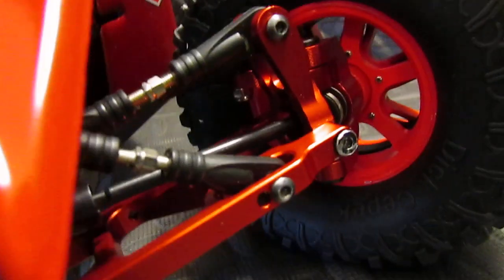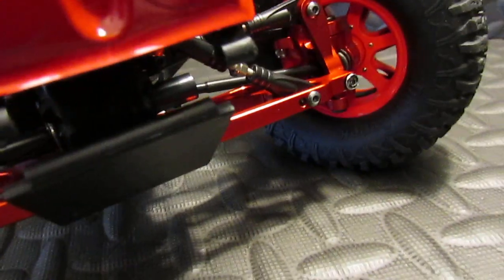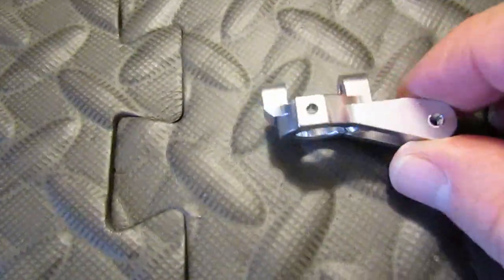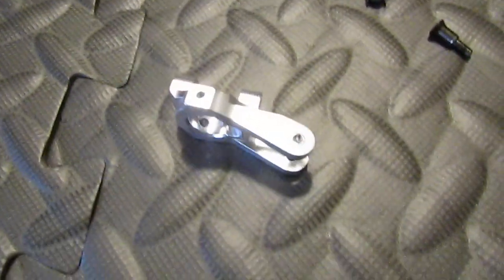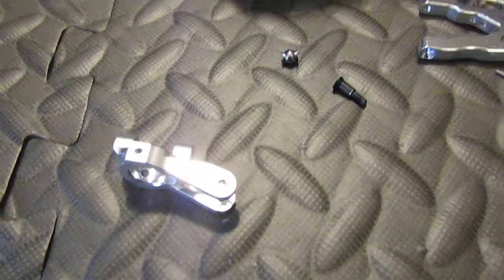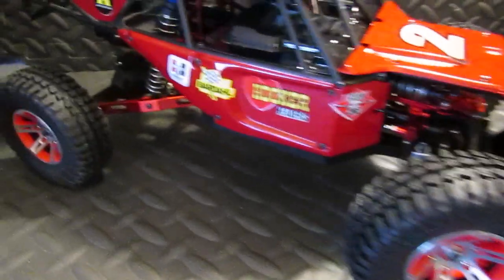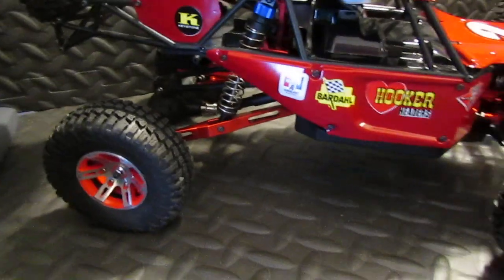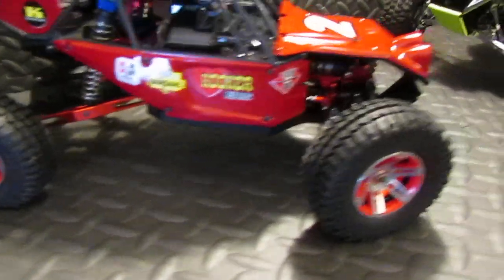You can see it goes right through that hole. If you put a nut in the inside of that, it might take up too much space and hit your drive shaft. So just tap this thing and you'll be okay, because I did it on both of these. Now anytime you're putting these together, use copious amounts of Loctite, because anything that you are bolting metal to metal, you want to put some Loctite on anytime, but particularly with the difference between these materials being steel and aluminum.